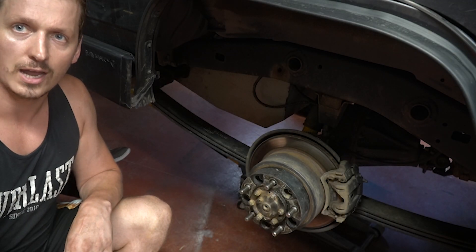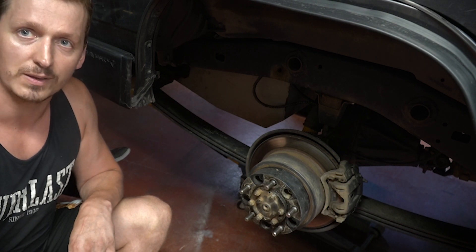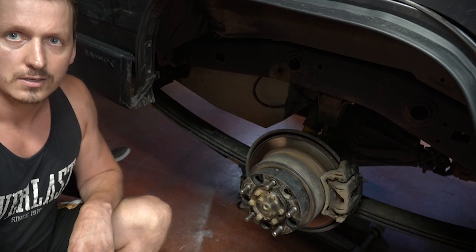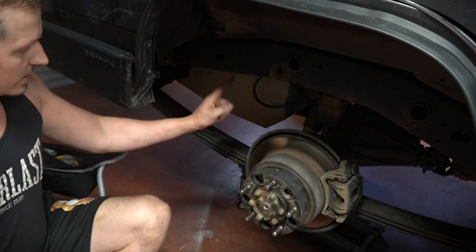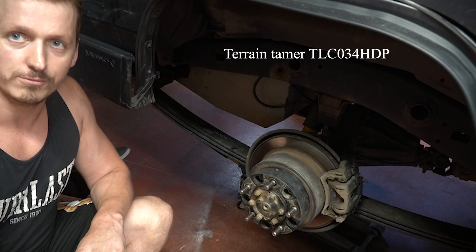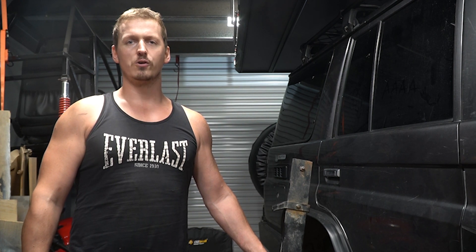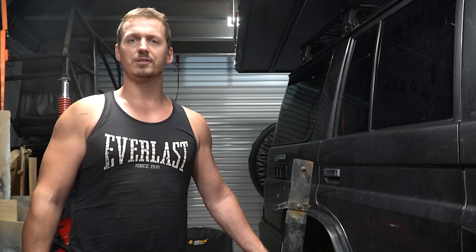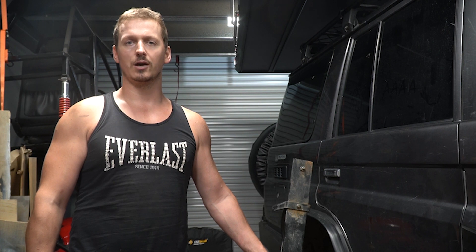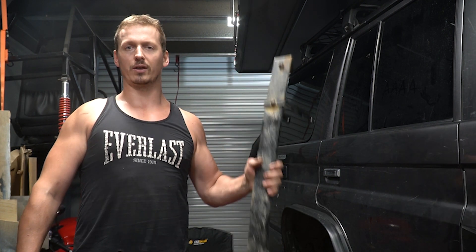You've made it this far. Now it's time for more of me telling you how bad things are from the box when you buy very expensive suspension items, starting with heavy duty parabolic leaf springs. From the box, they are awful. Here's why: when you buy these leaf springs, they are massively overrated for what they are — rated from 300 to 700 kilos — and that's because of this ridiculously excessive overkill spring that goes on the bottom of it.